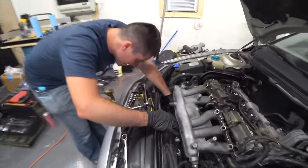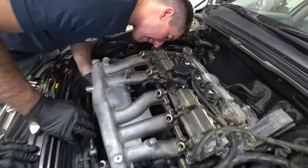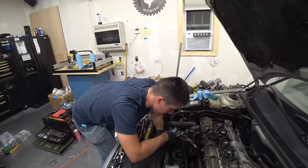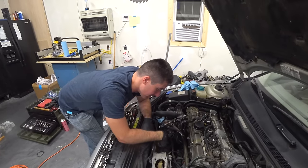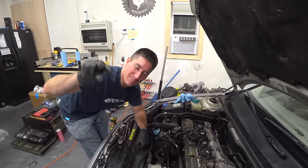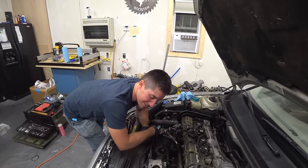I forgot to undo the throttle body, so let's get back under there. There will be just one harness and there's a clamp on the throttle body. Get this harness off, get the throttle body off, and we can get the whole thing out. This was a nightmare — the connector for the throttle body is down there in front of the starter, and you can't get it off without taking off the bracket by the starter because it's a big six-pin connector. So we had to unbolt the throttle body off the bottom of the intake while the intake was still in the car basically.